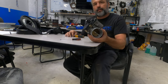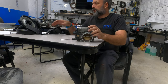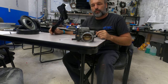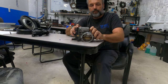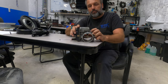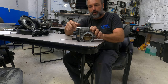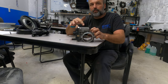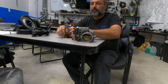What I have here is a throttle body for a 2007 to 2011 Chevy Silverado. The way the throttle body works is when the driver presses the accelerator pedal or activates the cruise control, the computer sends power to the throttle body. The motor in the throttle body opens the throttle to a percentage. The automatic default position of the throttle is closed, so if you were to unplug the electrical connector or there was a problem with the computer, the throttle body should automatically close.